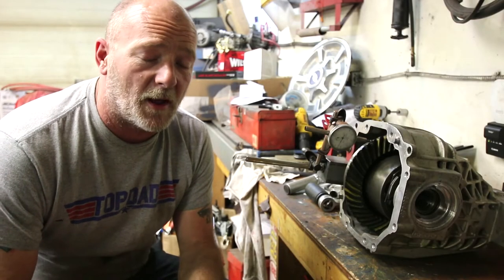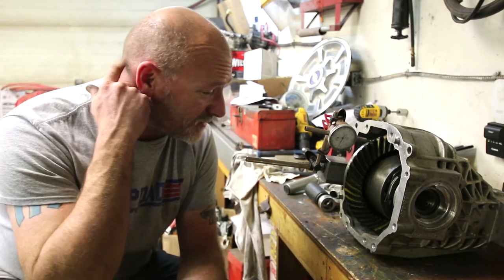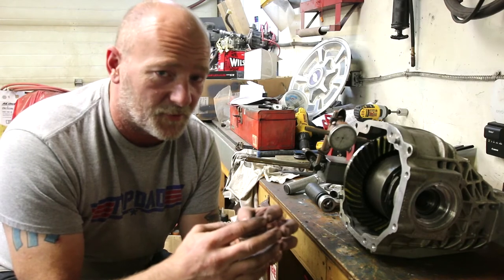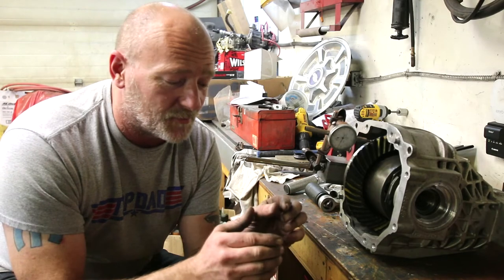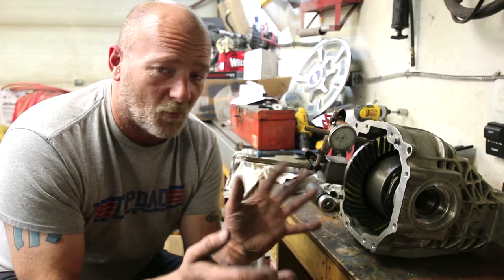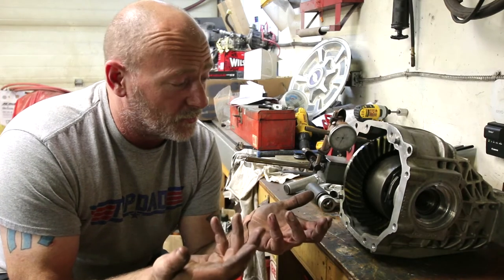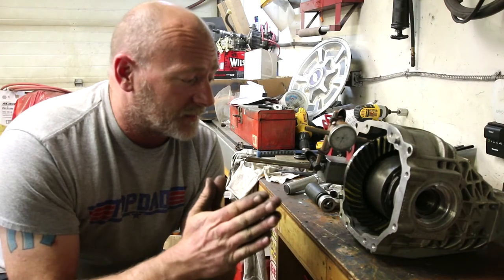Alright guys, so we're happy now. I mixed up my shims, not side to side, but they're like a stack of shims together, right? So I took the middle stacks out of the two larger casings that you noticed, and what I didn't realize was one of the outer casings, one of the larger shims, was actually 20 thou different size. So I completely screwed up when I mismatched my shims, because I put it all together, torqued everything down, and then I couldn't move the pinion. I'm like, what is going on? So it turns out, I remeasured everything, figured out what I did wrong, and then I actually got it right.